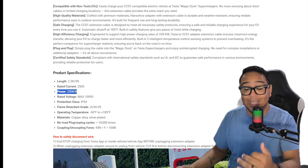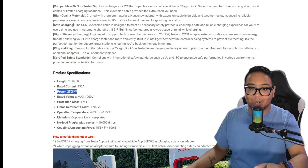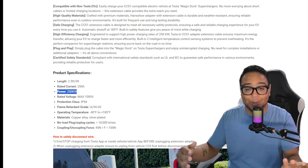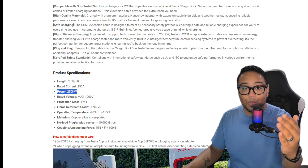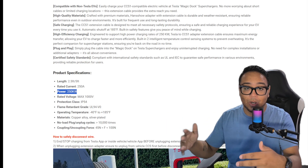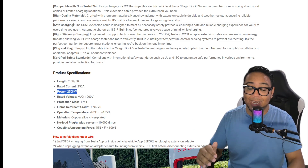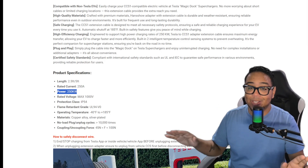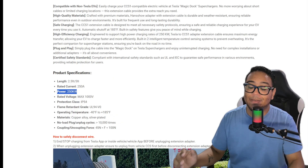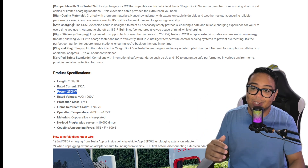I did get 205 kilowatts for a little bit, but then it dropped down. I switched charging stalls, and it had a chance to cool down — it picked back up at 205 until the normal battery curve took effect, and then it was charging fine. So depending on your vehicle and the voltage you charge at, you may run into thermal throttling, but it didn't feel too crazy hot to the touch — nothing dangerous.